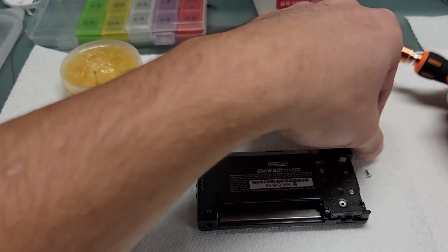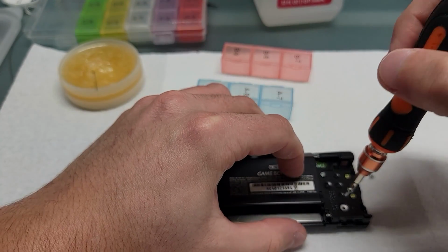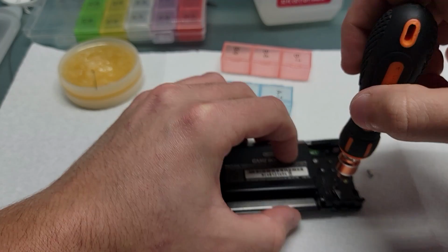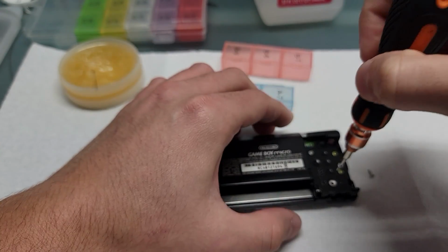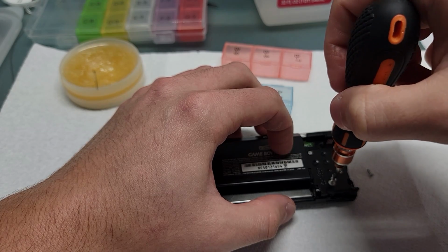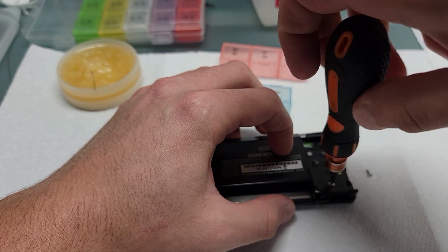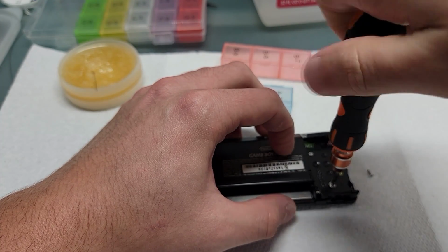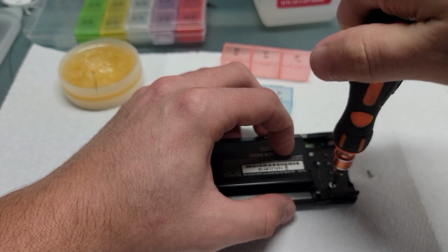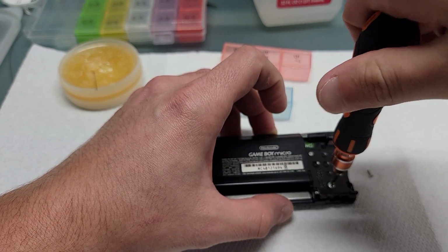These screws are particularly long, so you want to make sure that you push them in all the way and then start tightening them. So you'll see here that it kind of just drops through the console. I started screwing too early and then it dropped. A few back turns, you'll hear the click and then you start tightening. And when you start to feel resistance, you give it a few knocks to make sure it's good and tight.